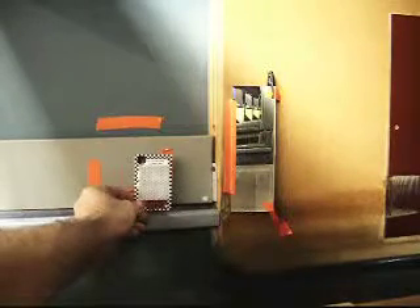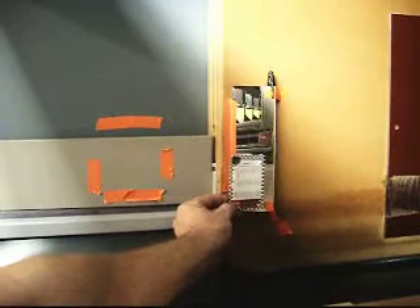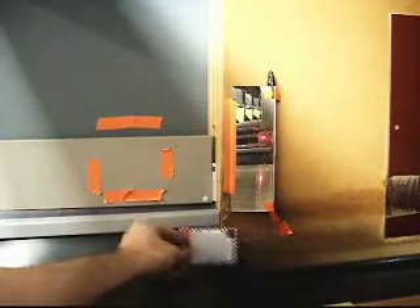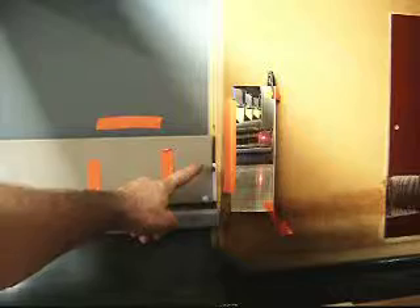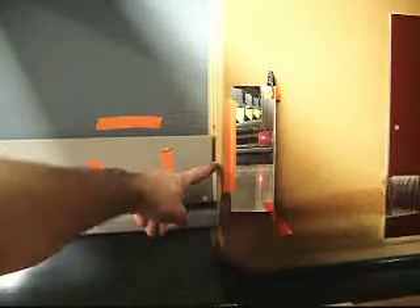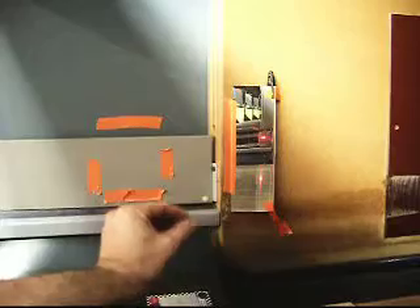Alright, so there's the edge of the left side of the beam. Let's check the edge of the right side. I like that a lot better — it at least gets onto this wood some, so I know it's really got that reflector right in the center. But now I'm not satisfied with my up and down. I can see how high we are — I'm only getting about three quarters of this reflector. I'm zeroed up from left to right, but I'm not zeroed top to bottom.